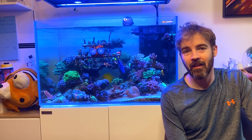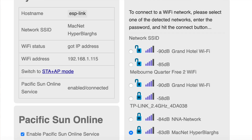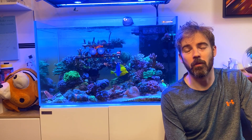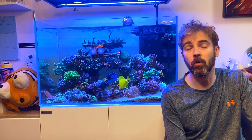The setup process from there was really simple. Upon powering it on, the unit will be broadcasting its own Wi-Fi network. You join that — the password is on a sticker on the back of the unit — and then you're brought to a screen where you simply select your Wi-Fi network from a list, put in the password, and press save. The unit will then restart, you rejoin your own Wi-Fi network, and you can go to its IP address and access its interface on your own Wi-Fi. Once you've done that, you simply put in your login details to your Pacific Sun cloud account and the connection is made. Your calcium reactor is now on the cloud, and if you have other Pacific Sun products that are also on the cloud, they're all able to talk to each other.